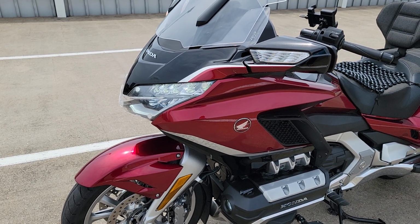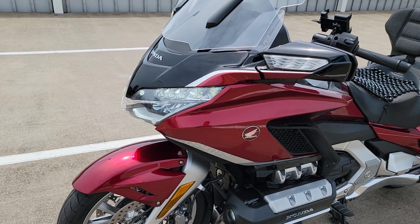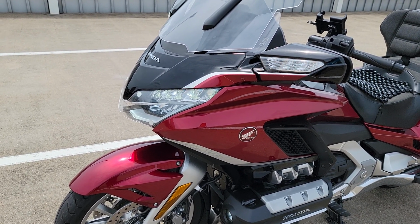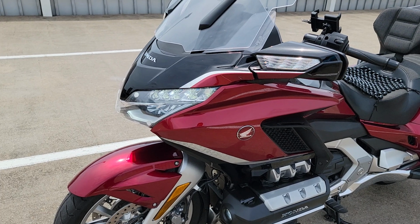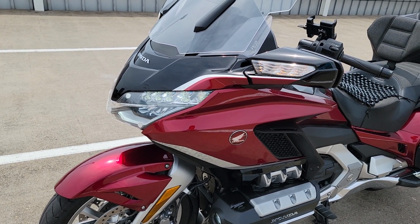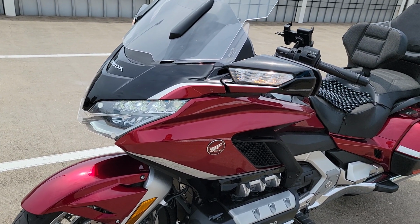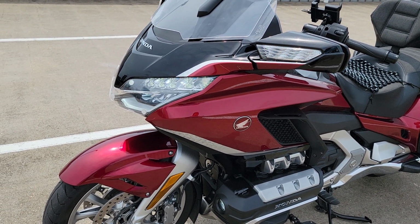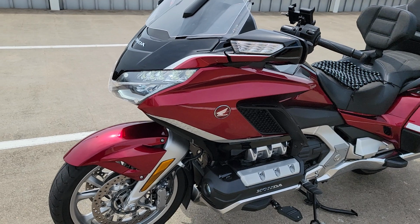But what I can tell you about it is, especially on the freeway in the US, freeway or motorway as it's known in the rest of the world, those old freeways, especially cement freeways, right? Not the tar ones, the cement ones, when you have one block of cement ending and then the other block starting, there is an undulation or an abrupt change, the flow is not smooth. And when you go over that at a slightly lower speed, let's say below 55 miles an hour, that's when you will notice the front suspension bottoming out a little bit, and you will feel it through the handlebar. But it is dependent on the speed at which you're traveling.